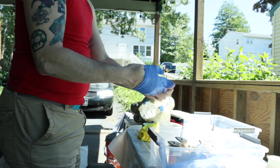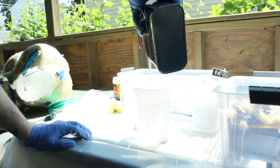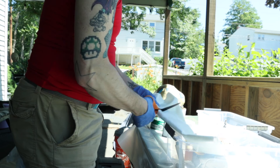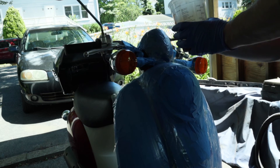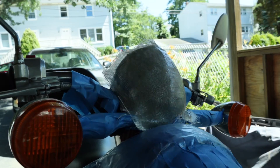Once that was all set, I mixed up my fiberglass. I picked this up at Home Depot — you can grab it at Walmart, they kind of have it anywhere. It's made by Bondo. It's like the cheap version, and I didn't want to spend a lot on the resin itself. I'm using a mixture of the woven mat and the chopped mat. The chopped mat is more fringy — when you pull it apart it has a lot more hairs, so they interlock together making it stronger. The woven mat looks like a piece of fabric — it lays a little bit better, but you have to put more layers to make it stronger. So I'm using a mixture of both materials.